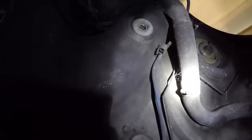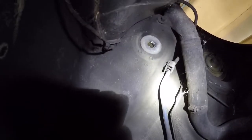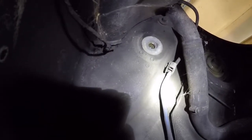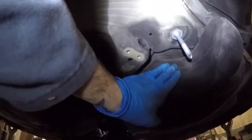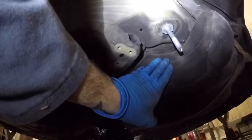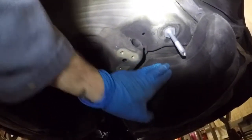Please be careful welding this — there's a lot of fuel here. You're welding right up against a fuel tank on this side and right up against a fuel tank on that side. So make sure you have no fuel leaks. I'll show you what we do to try and prevent any kind of damage, fire, or explosion, because that can be very dangerous.